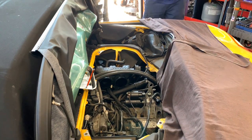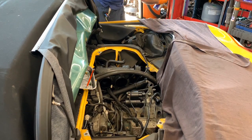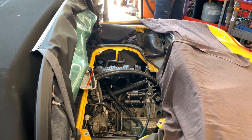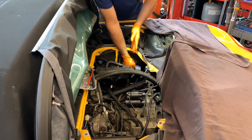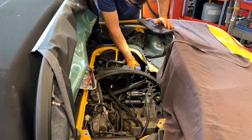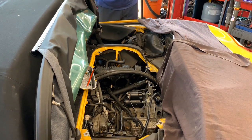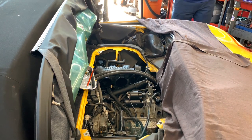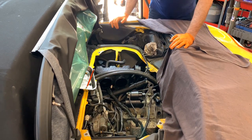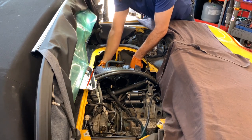If the O-ring fights you, I have found that a little bit of WD-40 makes it just go in and click perfect. That will get dry as soon as the car starts. You see, I was fighting that wire, I mean that connection, and the WD-40 went boom. Took the time to wash all the intake manifolds and everything. I like to work with clean parts.